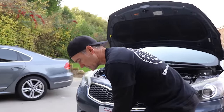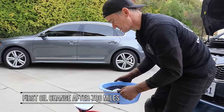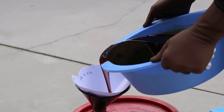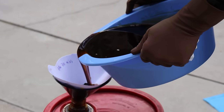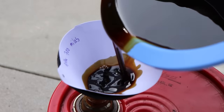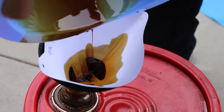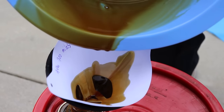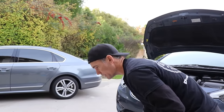We got the first oil change done — drained the oil and we're going to run it through our paint strainer. This is basically 700 miles on it. The oil actually doesn't look that bad, surprisingly. Let's see if we got anything — any particles, any sludge residue. Wow, surprising — so it's either there's still stuff stuck on the walls, or we've got it pretty clean. The plan is to go ahead and do the diesel flush: one quart of diesel with fresh oil and a fresh filter, run that for 20 minutes, then dump it out and see if anything washes out.